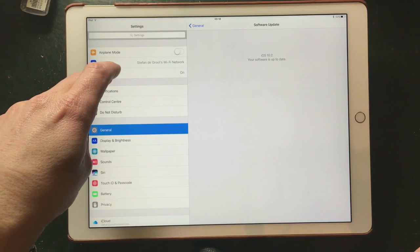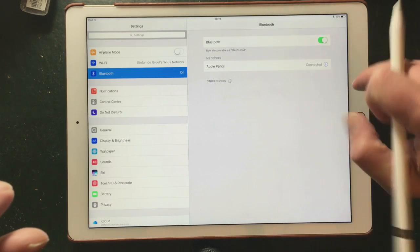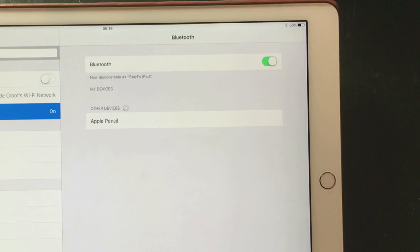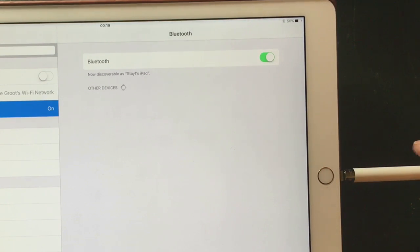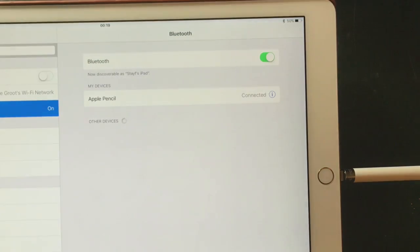The best thing you can do is go to Bluetooth settings and then press on the Apple Pencil. Usually you don't see Apple Pencil there, or you see other devices and it doesn't recognize the Apple Pencil. Just press on the 'i' icon and then say 'Forget This Device.' Then put Bluetooth off and on again, and then pair your Apple Pencil again. You'll get the pop-up window that asks 'Bluetooth Pairing Request — Apple Pencil would like to pair with your iPad.' Press pair and your Apple Pencil is connected to your iPad Pro again.